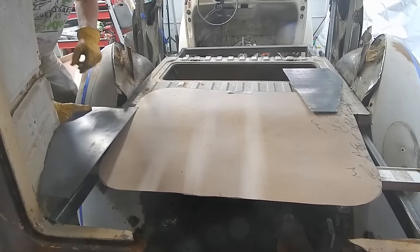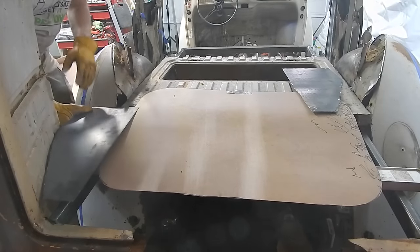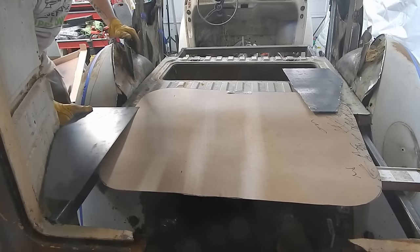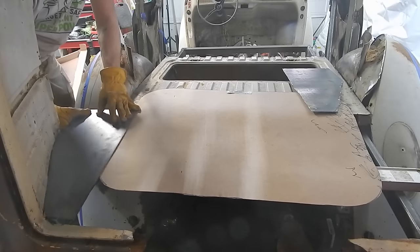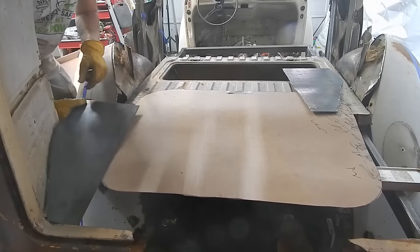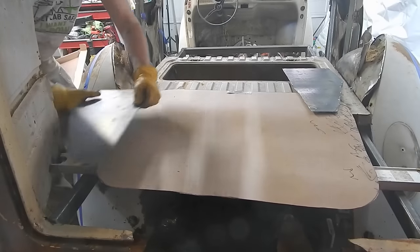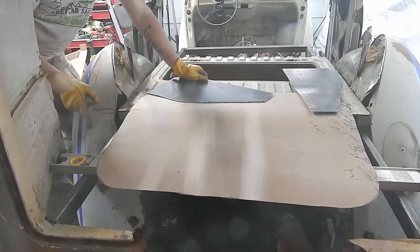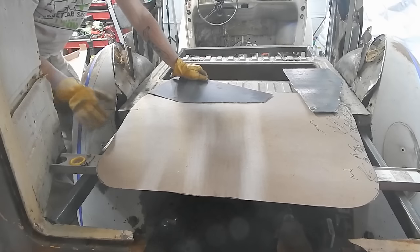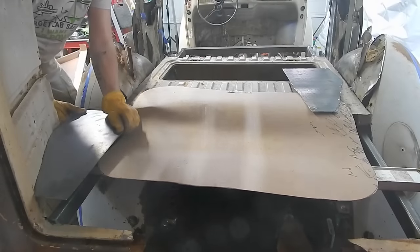Being that this fender will be part of the wheel well, eventually it will be something right here. I've got to make it airtight — I don't want the fumes coming in. But for the moment it's just a little bit of overhang, like so. Here's the catch: because of the way I built the outriggers and this floor, I've got a two-and-a-half-inch gap. So I'm going to need to make a little weird box that's two and a half inches up, level, out of some thinner tube to hold this where it is.